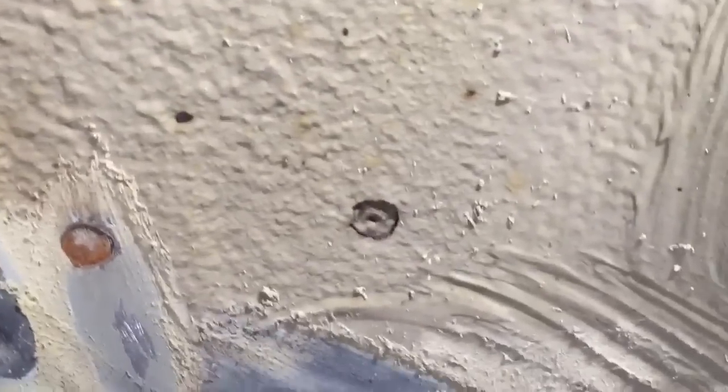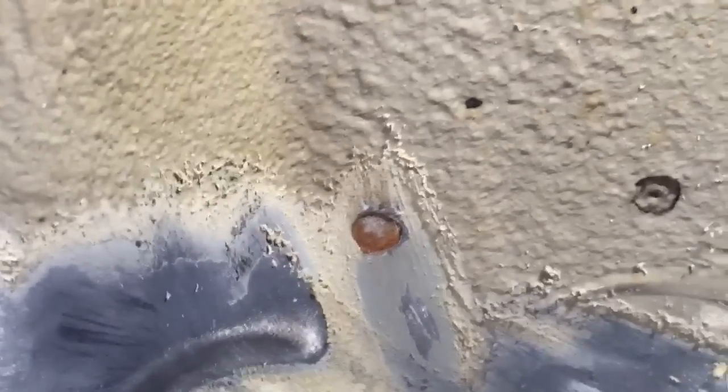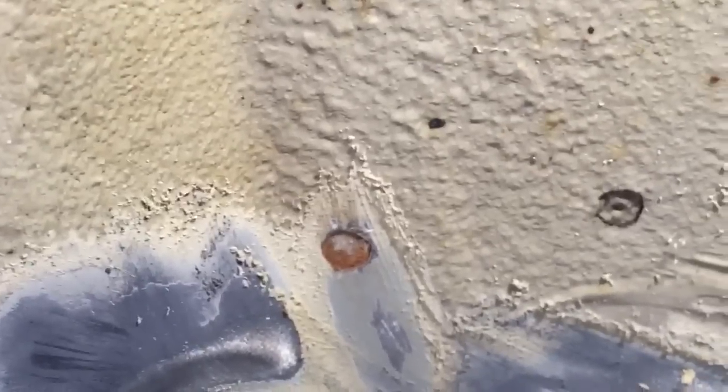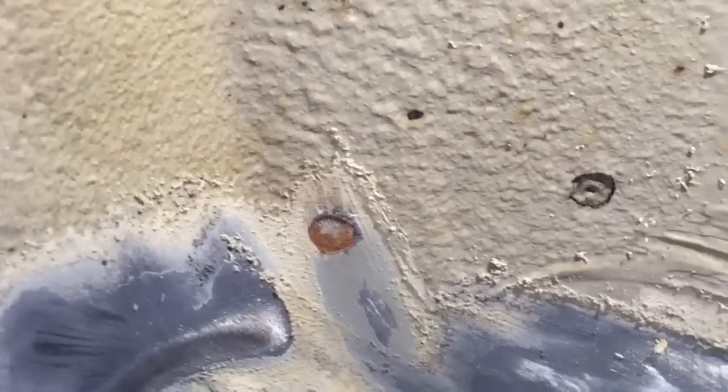And then we knew we had one up there, failed spot weld there. And I'm just taking some sealer off here and we got what looks like a definite spot weld failure because of the corrosion in that. That was all under the sealer, so how moisture's got in there, not quite sure.